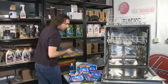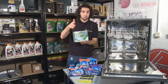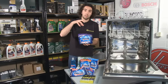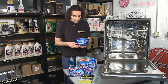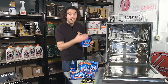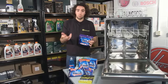So that's salt. In terms of detergent there's a huge choice available, starting with quite the basic type which is just the detergent itself, going up to products which are an all-in-one and as well as using detergent also contain the salt and the rinse aid. If you've gone for a product that contains salt, it's a good idea to put salt in your machine anyway if you live in an area that has particularly hard water — you want that water to be really soft so that your detergent can work well.